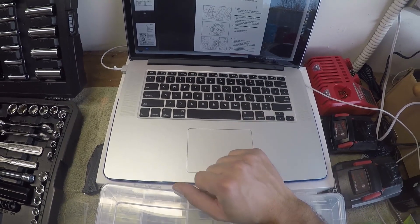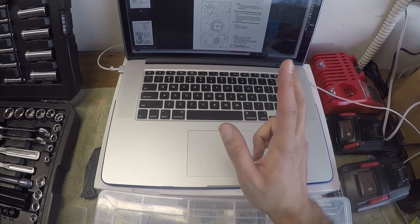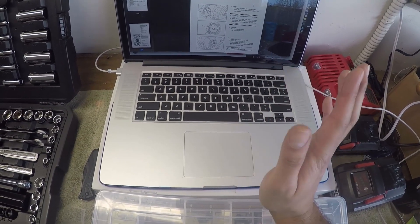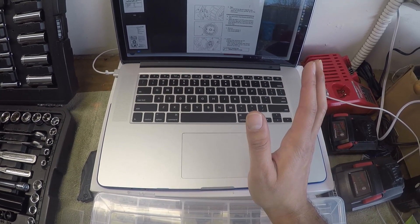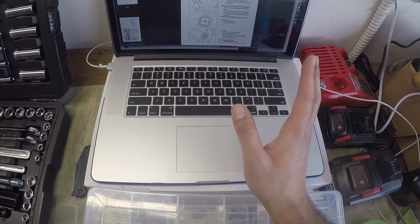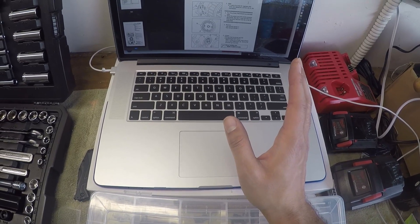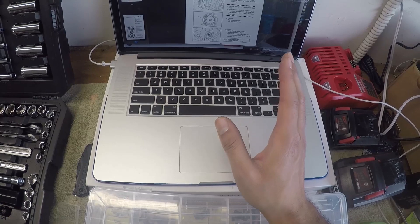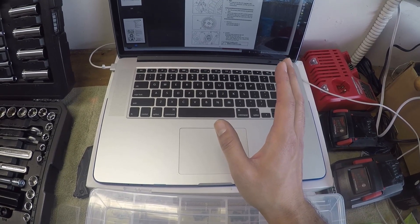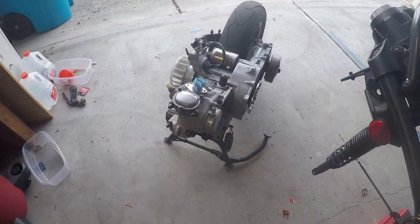Step 1: remove the air guide, the air shroud for cylinder 3. The variator belt case was already off from a while ago. The shock over-assembly and swing arm — we took that off; the shock absorbers are just hanging there. Next: remove the breather o-ring, the breather, the o-ring, and the valve cover — both the intake and exhaust valve covers.